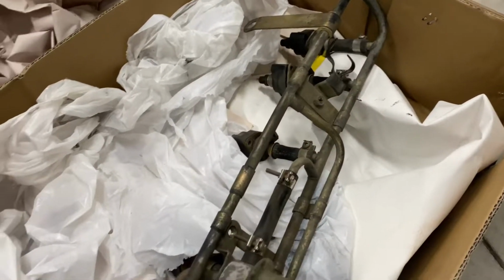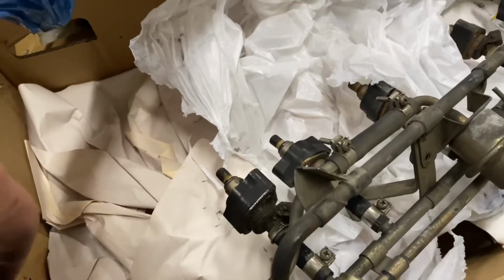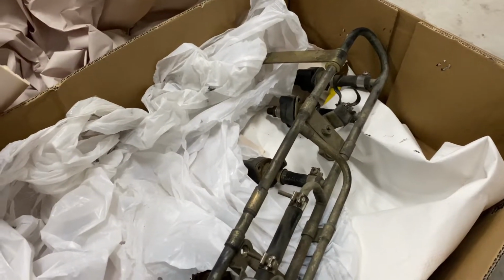These are our new injectors. These are, I want to say, approximately 80 cc's more than the stock 280Z. I think stock 280Z is 180 and these are like 260, 265. So we'll be able to flow approximately 1/3 more fuel through these injectors and be able to keep up with our 8 PSI goal. We have an 8 PSI wastegate spring in there right now. I think 12-ish is the max you can run on these injectors, so we're not hitting that number, which is good. We're going to stay below that in a safe threshold.